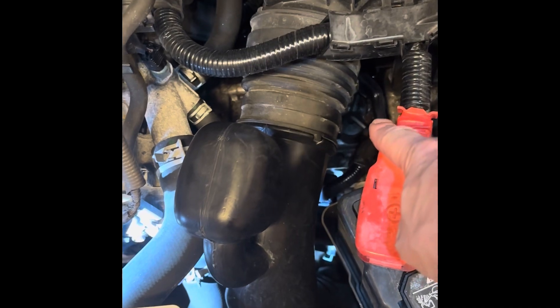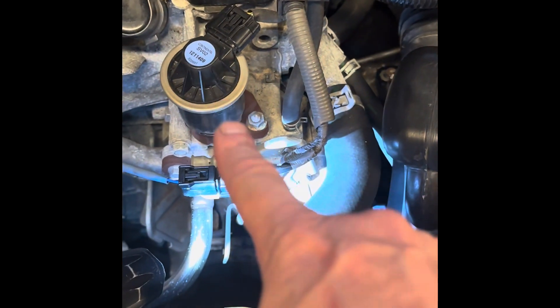The transmission plug is over here, but the problem component is a little valve. If you look down underneath here, I'm going to put this metal pointer down here — it's this little black thing at the end of the pointer. This thing is dirty and plugged up. So what we need to do is get underneath there and pull that off, and then we're going to clean that out.